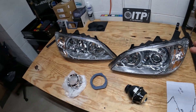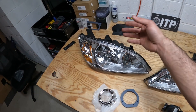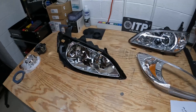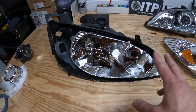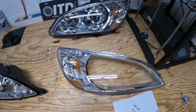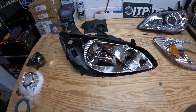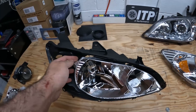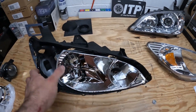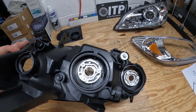I'm gonna take you guys along, and first things first, I gotta bake this headlight open. So as you can see, the lens has been removed. Now the next step is gonna be to pop this chrome piece off of the actual housing. In order to do that, I have to unscrew this adjuster bolt.